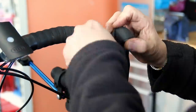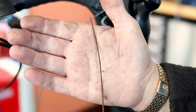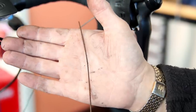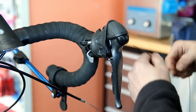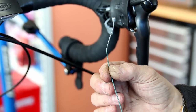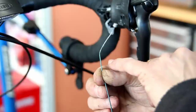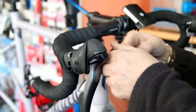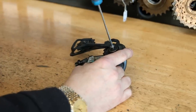We'll get all the brakes off and get out the old cables - the cables were in a sorry state on most of this bike. You can see the corrosion on the bottom where I snipped off the rear derailleur cable; it had corroded through and was holding in the outer. It would go up the gears but wouldn't drop fully down, and this is something quite common on Shimano - you get a kink on the shifter itself, the casing begins to fray, and you get a frayed end inside the shifter holding the shape. New cables will make the gear actuation so much smoother.